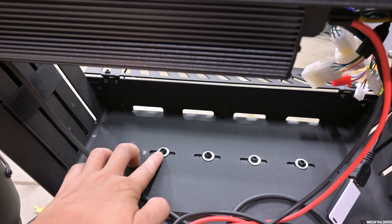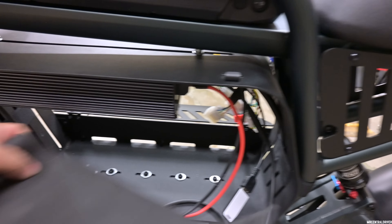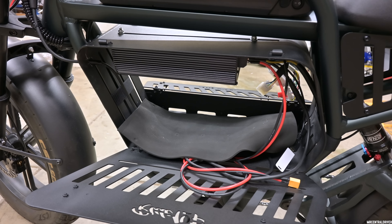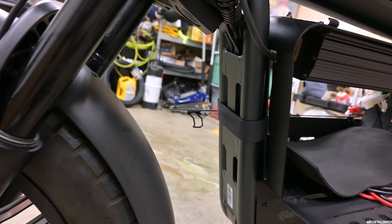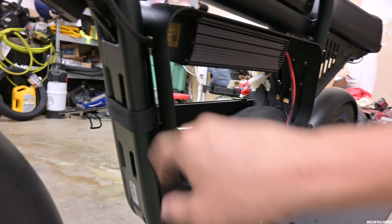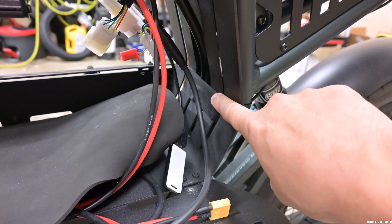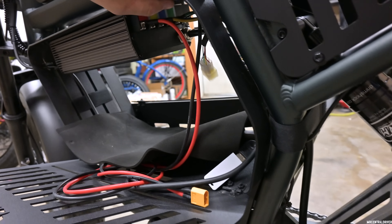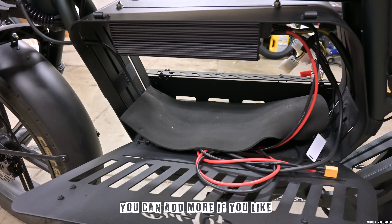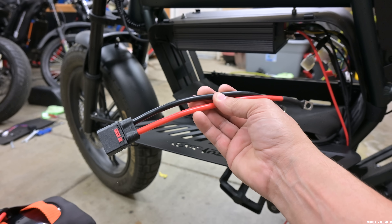You definitely don't want any issues with puncturing the battery down here, so I'd get some flat screws from Home Depot. I'd still highly suggest using a foam mat in there so the battery sits on top of it — that will soften noise and protect it from the bolts underneath. I also added some straps between part three and part four, with links in the description. The strap goes through the cage on this side and holds it in the front, and I put one in the back as well, so the cage is secured front and back and won't swing side to side on fast turns. Before the battery goes in, we need to hook up this cable to the controller first, because we won't have room once the battery is inside.